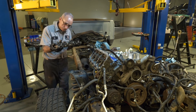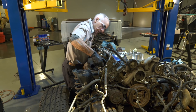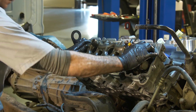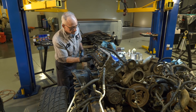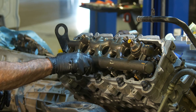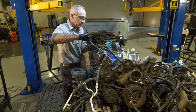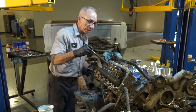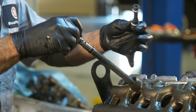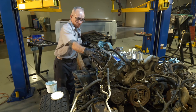This is called the wave rail — you can see each injector nipple. I'm installing the hold-down bolts for the wave rail. It's a T30 head, just make sure they're snug. This is a standpipe — this is what actually connects the branch tube to the wave rail. The oil comes up from the branch tube, from the high pressure pump through the branch tube, up to the standpipe, and then out through the wave rail.